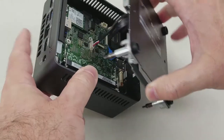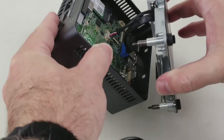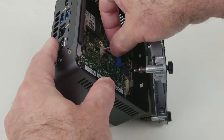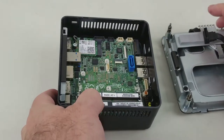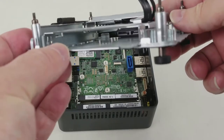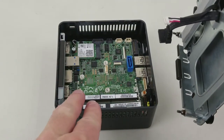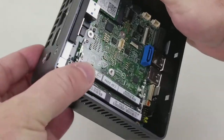Now with our static protection message covered, I want to go ahead and take off the bottom. The first thing I noticed is the SATA drive power connector has moved, making it more difficult to fold the bottom plate out of the way to put the DIMMs and SSD in. I'll go ahead and unplug the connectors — try to grab them by the connector housing and not the wires — and fold this out of the way. The drive bay takes 2.5-inch drives up to 9.5mm thick; they slide in, plug in, and a screw holds them in place.